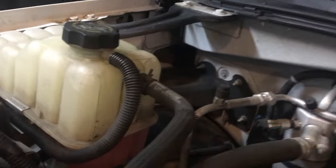I pressurized the system and followed every coolant line I could — there are some under here under the air intake. I followed everything. It wasn't leaking super fast, but I found the leak. The tray at the bottom of the core support was pretty wet, and you can see on that wire harness there, it's wet.